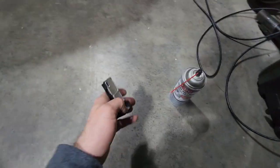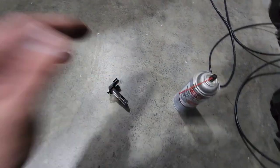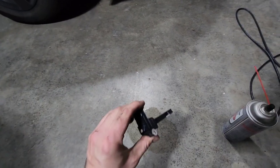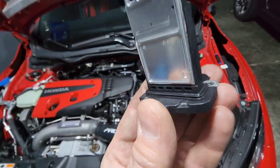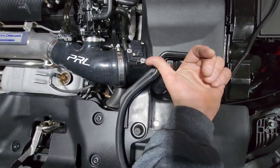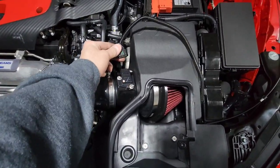There's your MAF. Another thing you can do — and I do it every time I replace my air filter — get some mass airflow sensor cleaner. Don't use anything else. Right in that hole, that opening — the rest of this is pretty much sealed up — just spray that real good and let it blow out and dry a minute. Keep in mind there is a seal around the bottom of this to make sure it sticks to your MAF and not your old housing. The hole here — you're going to put it straight so the incoming air passes through that hole, and that's how it gets its reading.